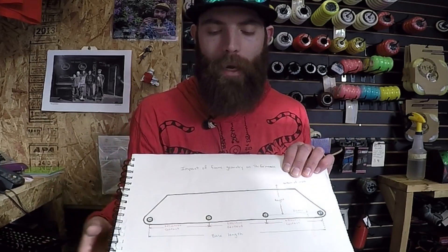Let's talk about the base. The relationship is fairly easy to understand: the longer the frame is, the more stable the frame will be. However, a longer frame is less maneuverable — it's more difficult to perform intricate turns and slalom-type maneuvers. A shorter frame is going to be less stable, but it's going to maneuver a lot better.